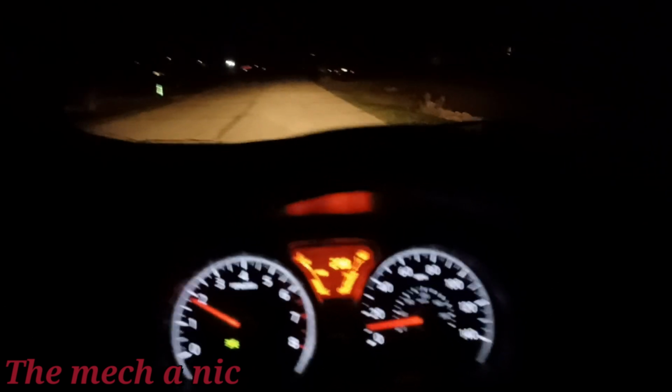So it just goes to show, don't overlook your brake fluid. I'm guilty of that as well. I seriously thought, okay, I'm just gonna go ahead and change the fluid, not because it needs it, but it's just getting old, and I figured I could get a good YouTube video out of it. But boy, was I wrong, because this made a massive difference. Over the years, the brake fluid starts to break down and absorb moisture right out of the air. So yeah, don't overlook it. I feel like I'm in a different car. This is amazing. I'm so happy about this.